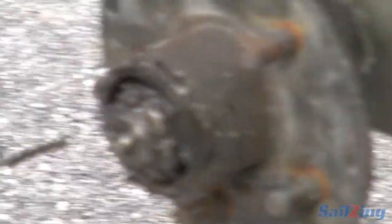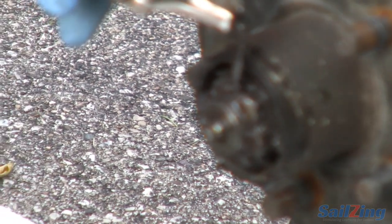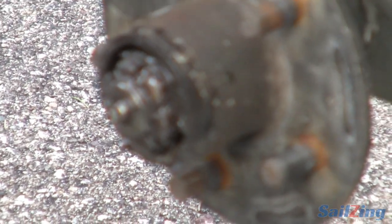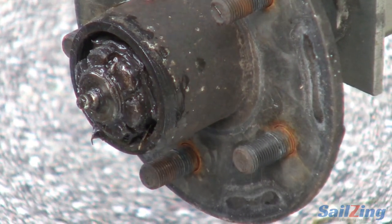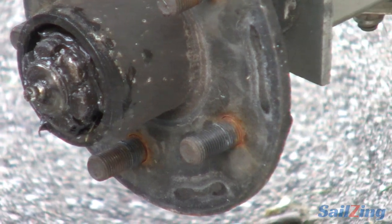The pin's out. Normally it'd be a cotter pin, but in this case they've used a bent piece of metal. The grease fitting goes all the way through to a hole in the back — it actually goes through these holes, so if it's not a fairly tight fit it'll just squirt out the front. These easy-lube sets are great for flushing your grease, but if the grease was contaminated, there was probably a reason it was contaminated.